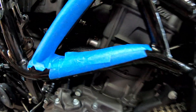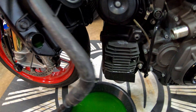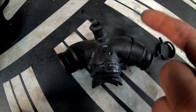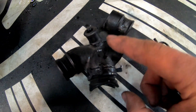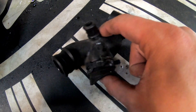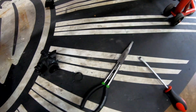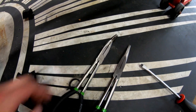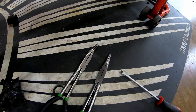I decided to start off with the hardest part first — this little T-junction right here where the recall is at. It has a hose that goes right into the top at a three-way union. What I did to make it easy was take a long razor blade and slip it down in so I could slide the clamp and piece off. I used a 90-degree long needle nose pliers. They do make a hose clamp tool specifically for this, but I wasn't planning on doing this so soon.